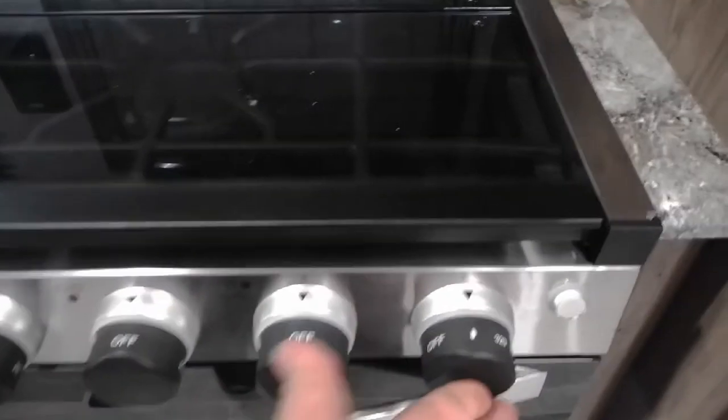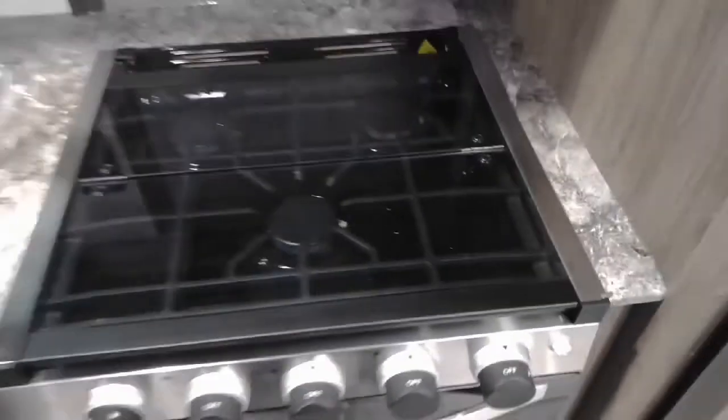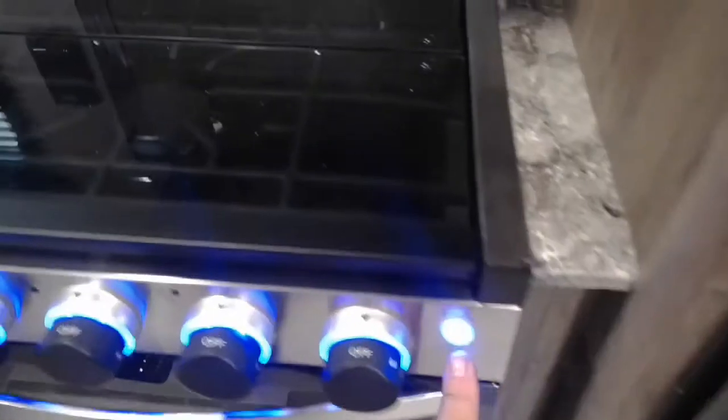So stove, sparker for the burners, and the oven. You're gonna put it on the flame, push it in, hold it. With that held, you'll spark it. Once it's lit, it takes about 10 seconds. You gotta hold the knob in. You can let it off. It should stay lit. Your oven pilot, that is, and then you can adjust your temp. This is gonna be your burner lights.